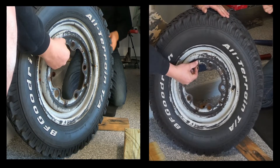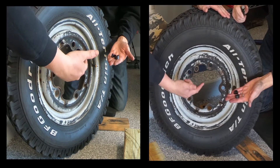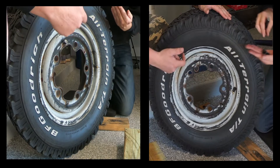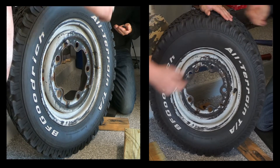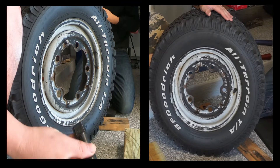You've got these little clips on there between the lug nuts that hold the hubcap on. They're held on with a little rivet and you've got to beat that rivet in with a hammer and the special tool, which holds the rivet and clears the back of the rim so you can set it down and beat the other side with the hammer.